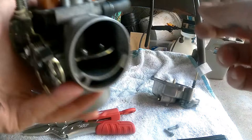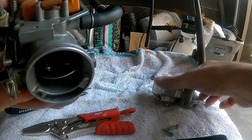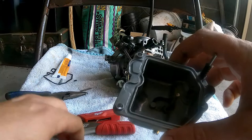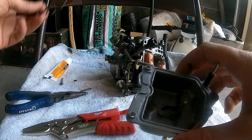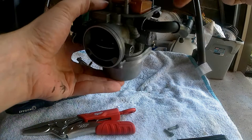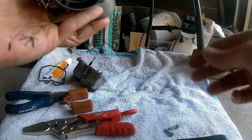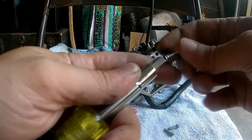Let's take the floats off. There's a little pin — get your pick tool and just pop it through and pull it out. Normally you'd have a gasket right in here. I used the pick and a Scotch-Brite to clean it up. There's a gasket right here and also another o-ring — a tiny little one. Let's take off the float and get the needle out of there. The needle just hangs there — take that off.